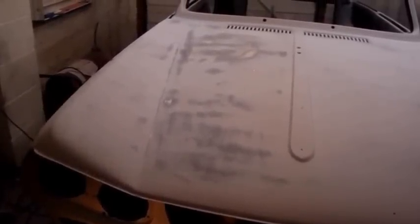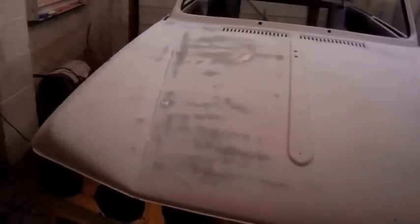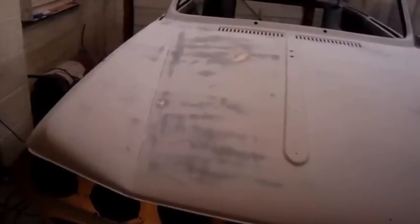it feels nice and flat. You can see a bit of shadowing from the primer underneath, but that is it. It's pretty flat. Half an hour done. Whereas this side, where I started with the 240, I created myself problems, you know. So 320 all the way for me.